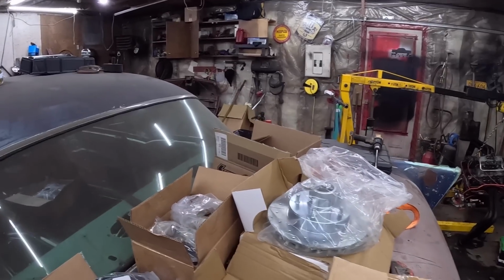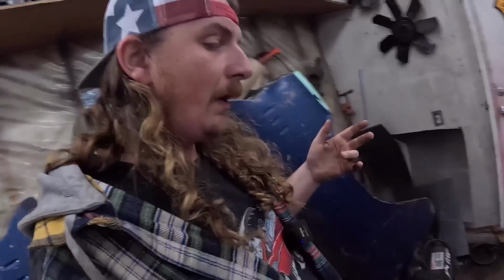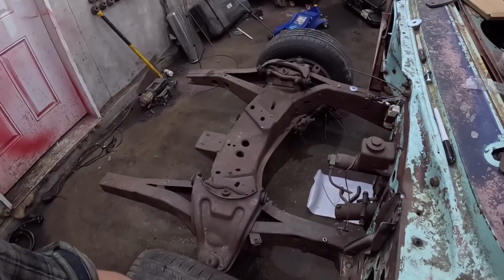But anyways, it's just like a reseller on eBay. And I got all this stuff, a disc brake kit. Because again, this is where I can never win, but Tri-5 Chevrolets. Four-wheel drum, single pot master, so that's not a great setup. So we're going to upgrade to disc, because even drums these days, man, one drum is like $100. Crazy. All this stuff together was, I want to say, $1,000 Canadian plus shipping and maybe some duty. So if you're in the USA, that's like $750 maybe.